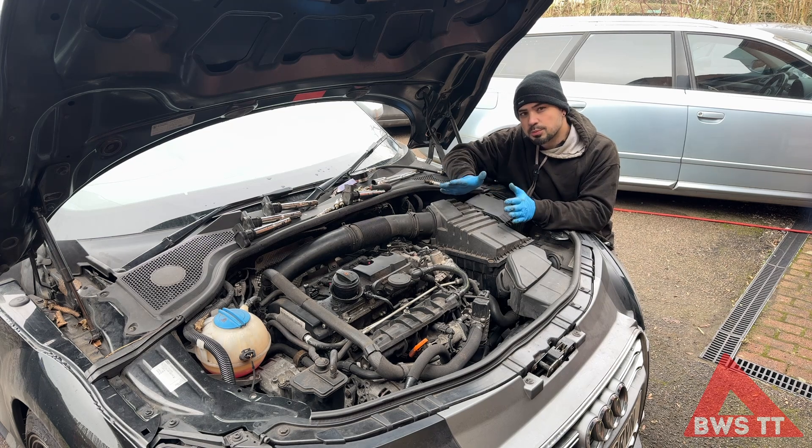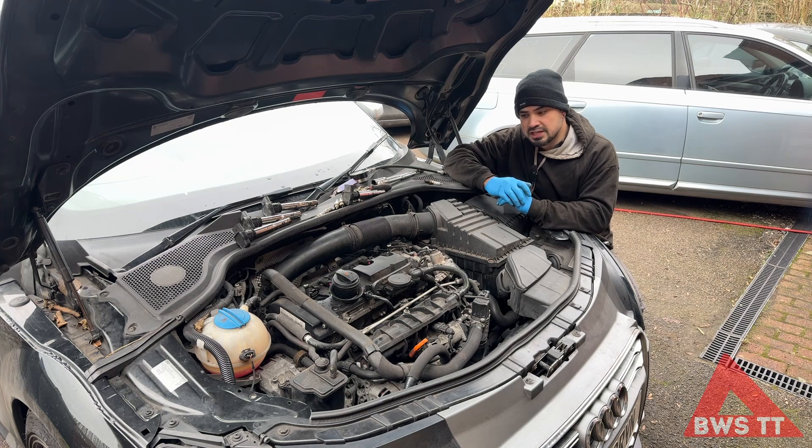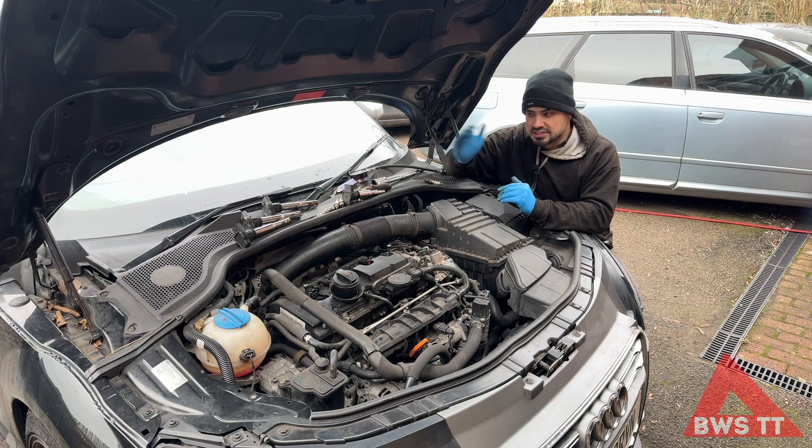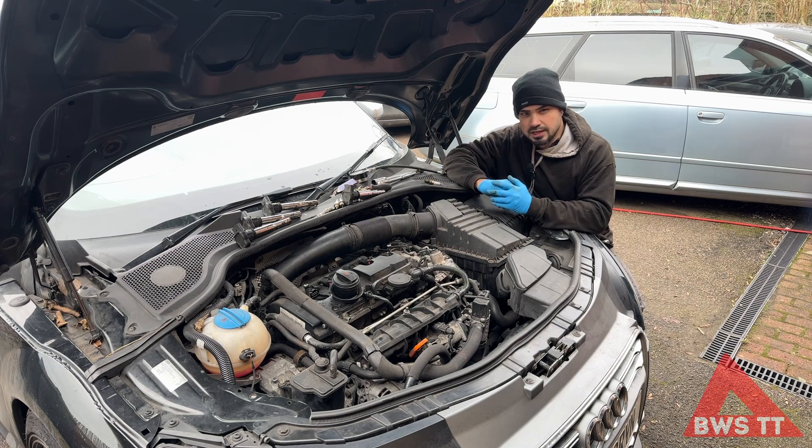A healthy engine on a hot compression test on these should be getting 180 to 200 PSI. I got in the 172 to 182 range, and the engine was quite hot but not at full operating temperature because I hadn't been taking it for a spirited drive, so it wasn't under load and wasn't getting really hot cylinder temps — I was able to handle the spark plugs. So maybe if I did the same again after a spirited drive I would get slightly higher results.